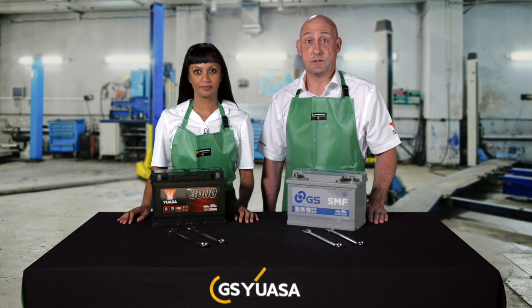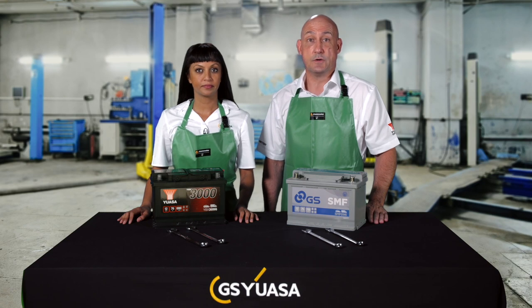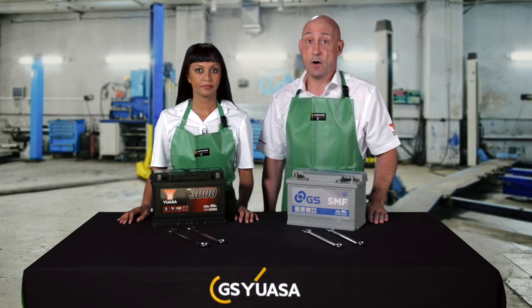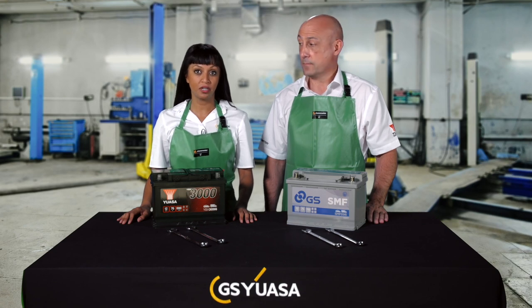There are various hazards associated with electrical energy when working with and maintaining lead-acid batteries. Conductive objects such as metal tools or jewellery can create accidental short circuits of battery terminals. This may generate sufficient heat to cause severe burns, create arcing, or cause any metal to melt and splash. Severe electrical shocks may also be received from faulty charging equipment.